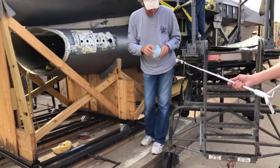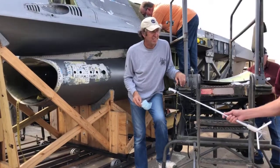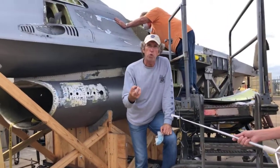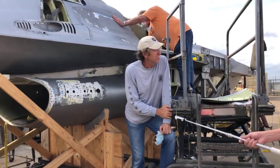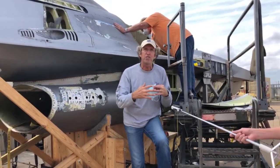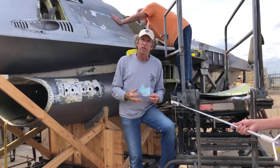This has been a very successful project. What do you think was the hardest part? Drilling out tons of rusted screws. This poor airplane was stored upside down for a long time. Quick-release nut plates had turned into little wads of rust, and those were tool steel screws. We burned up a lot of carbide grinders taking out the screw heads. Then once we got it open, we could take off the nut plates and we're replacing them so we can put the panels back on properly. We also had to figure out which skin overlapped which skin, because they had put a 10-inch gap in it. We ripped out all their bogus sheet metal work, and then making sure we had enough adjustment to get it lined up and put back together.